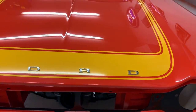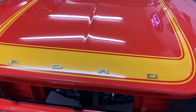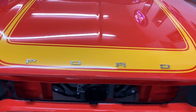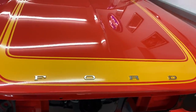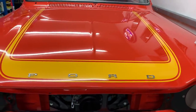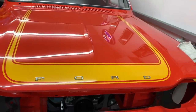There we have the badges fitted to the front and back. The back wasn't too bad once you drilled the insert out — they fitted into the boot lid perfectly. But the bonnet was a right pain — the holes were much, much smaller than they should be, tiny little holes. I had to open up the holes to 4.5mm, which I didn't like doing on a brand new painted shell, but I had no choice. I then touched up with a bit of paint and fitted the badges. They look absolutely spot on.